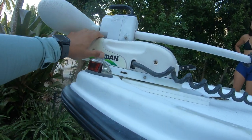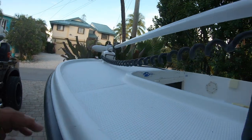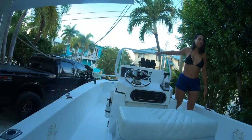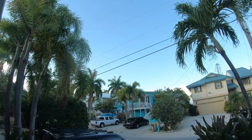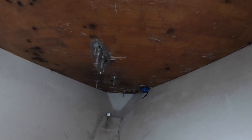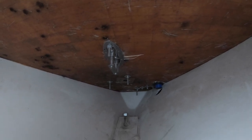This is a Rodan — they're manufactured here in Florida, great company. The next thing I'll show you is the installation underneath the bow for some of the parts that were used to mount it. There you can see the through cleat, the screws for the puck, and the starboard. All of it was installed with stainless steel hardware and sealed off with some 5200.